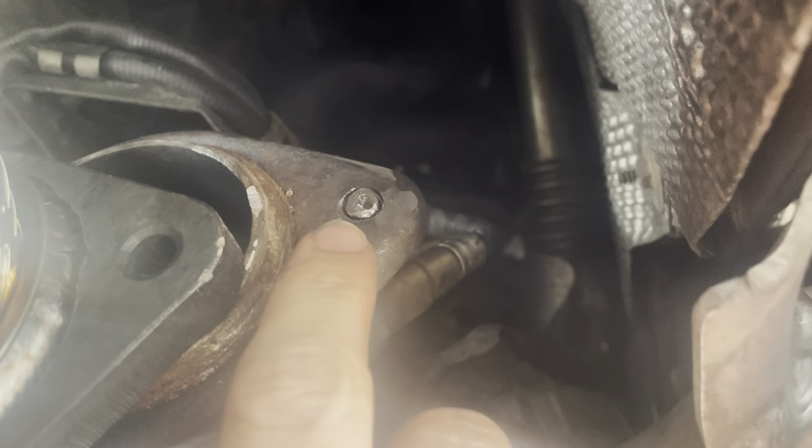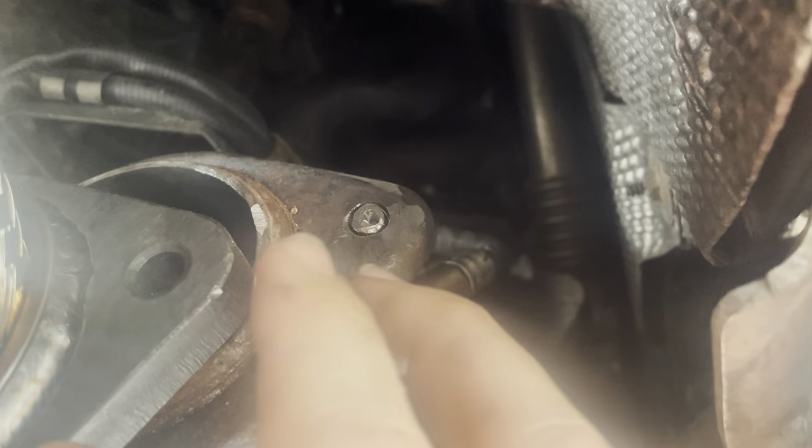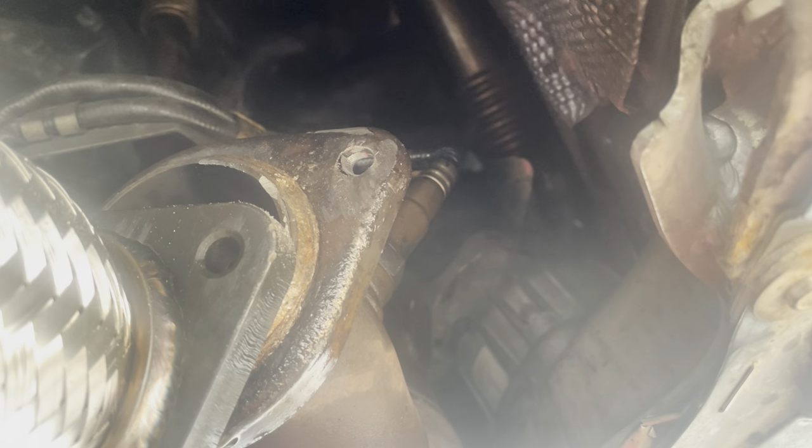This is the second one. What I've done is cut the stud head flat with a grinding disc, then a different approach - I've got a little 2mm metal drill bit and I've drilled a pilot hole, which I'm going to make bigger, because it took so long drilling it with the correct size bit before. I'm not enjoying this job at all - it's just taken ages and ages, although drilling with a 2mm bit is a lot quicker than starting with an 8mm bit. I've sharpened and blunted, resharpened and blunted, used cutting fluid, gone through several different drill bits. I've had enough - so I've had a dig around in the workshop and found my carbide bits. That's the answer - that's what I should have done in the first place.